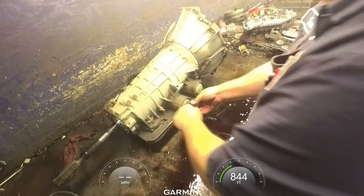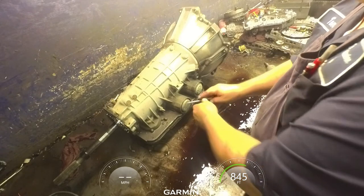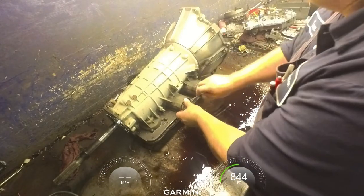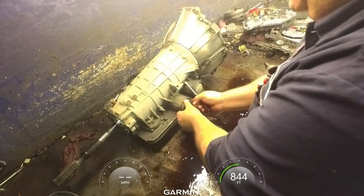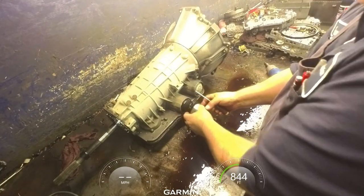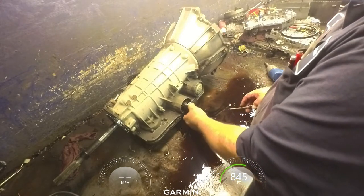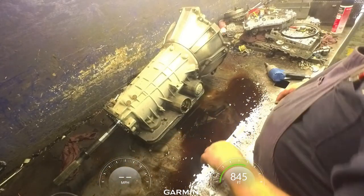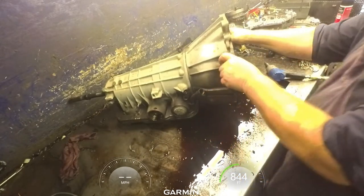Your servo covers are going to tell you which servo you have. The ZC is the biggest one, the AB is the next biggest, then BB, CB, DB, and FB. Personally I wouldn't use anything under a BB. If you've got something smaller than that, change the servo cover and the servo. The 5R55s usually have the ZC. The 4R55s and 4R44s usually have an AB and a BB. It's more holding power, and the levers in there give you more holding power.